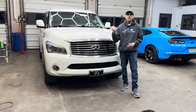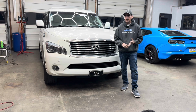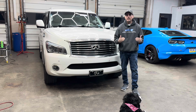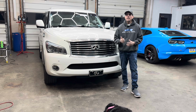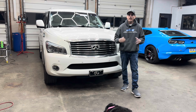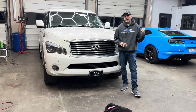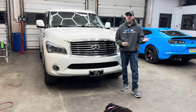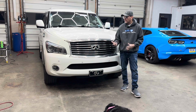And I found on this one, it's very, very touchy, along with Audi and Mercedes when it comes to the battery getting below a certain point. It just throws fits all over the place. And what happened in this case is it locked out the ignition, a relay or something. So I went in. The Carriage Trade has a bunch of excellent mechanics with their own OBD2. He came out, had it reset. We started it up. I got to hear it.